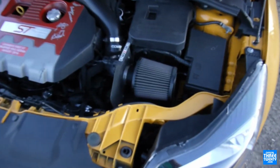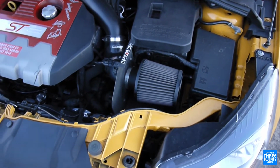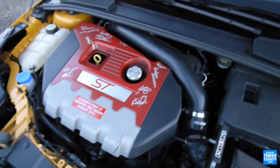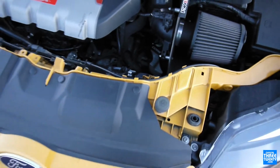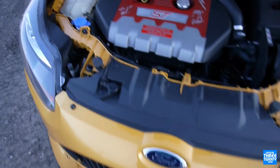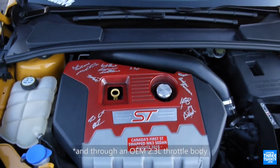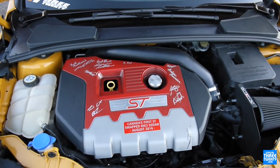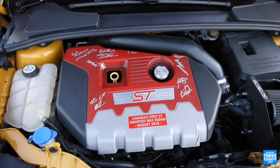So might as well follow the air's path here. It starts off with an FS Works intake, which is actually a carryover from my original engine. Heads on into a Cobb intake arm, of course down to stock turbo like I said, through stock intercooler piping. That's still factory, that's not a restriction yet. Into Mountune intercooler, more stock intercooler piping of course, and then on the exhaust side it heads through a Cobb downpipe, a catted downpipe, into an Agency Power exhaust and just shoots straight out.